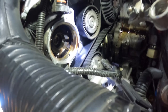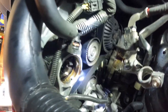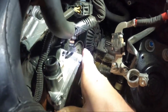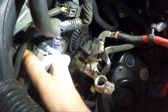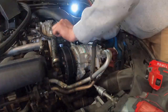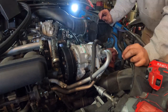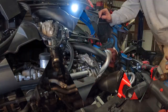After that we'll open it up and put the new seal in. These two blades right here are supposed to line up with the marks on the cams, so make sure if you're trying to put it in and it doesn't go in, line those up right here. Once they're lined up, slide it in just like that, then twist it — make sure there are no wires or anything blocking it — twist it to the position of the bolts. Tighten the bolts and that's it.